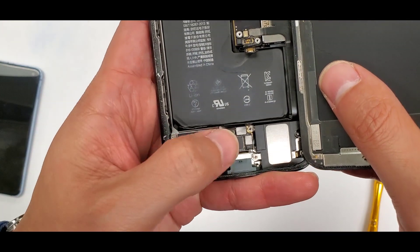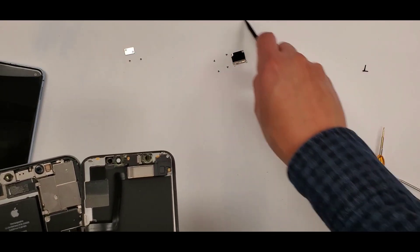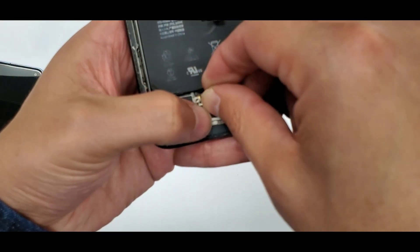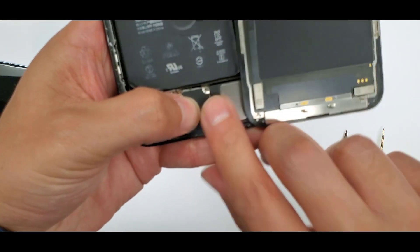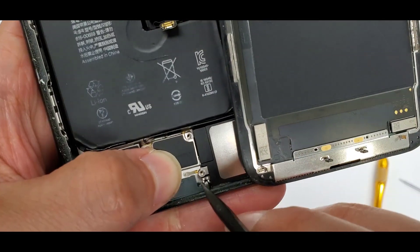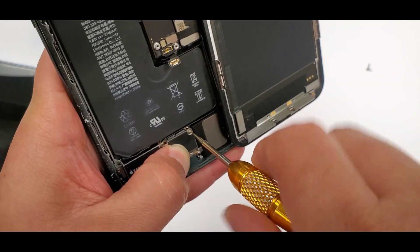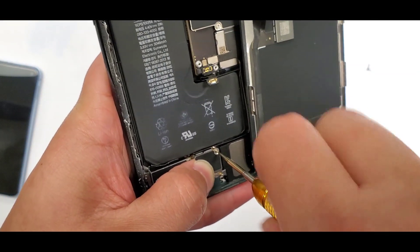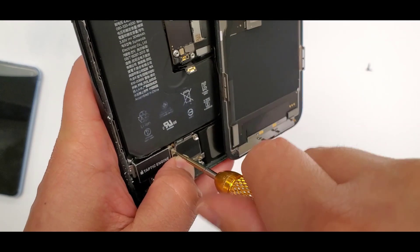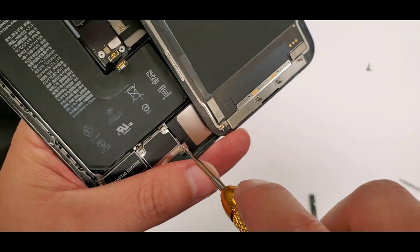That shield is connected. Now for the battery — we're gonna plug in the bottom battery connection and the shield that covers that section. There are four screws there. Place the shield, align the screw holes just like I'm showing, which makes it easier to put the screws back in without them falling off the screwdriver. We got the third screw and then the fourth screw.